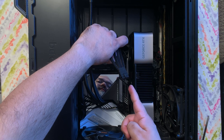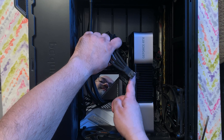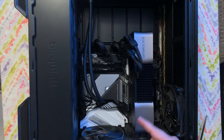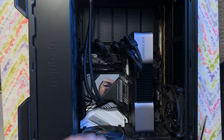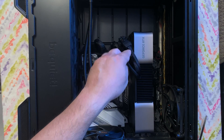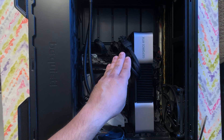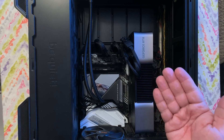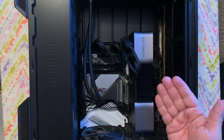I'm going to go ahead and connect the power connector to the GPU. There's a tab — it goes right up there, and the sensing pin should go in the bottom. You should hear a nice snap; if you don't, take it out and put it back in. One last check: make sure the cables are not touching the fan. I'm going to push these cables down — there is glass going on top and I don't want too much pressure on them. The only way to verify everything is connected correctly is to go ahead and try it.